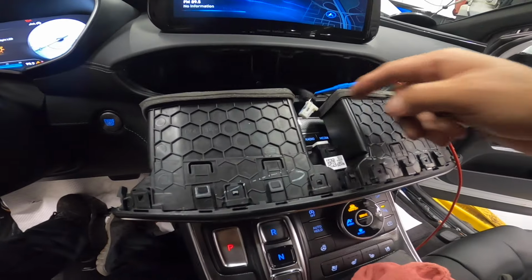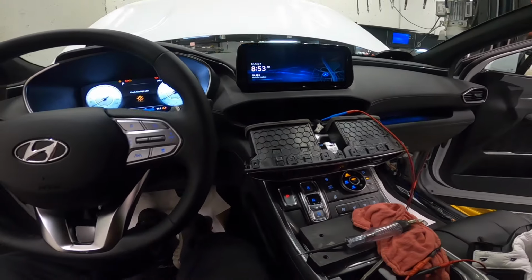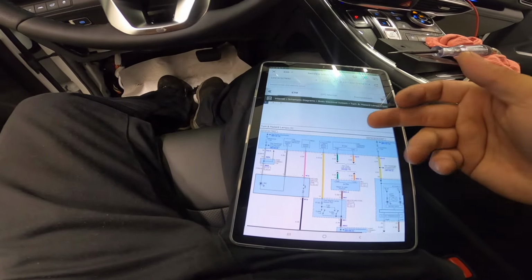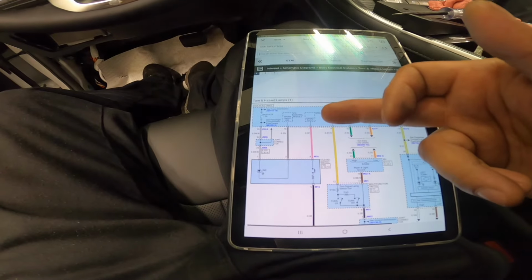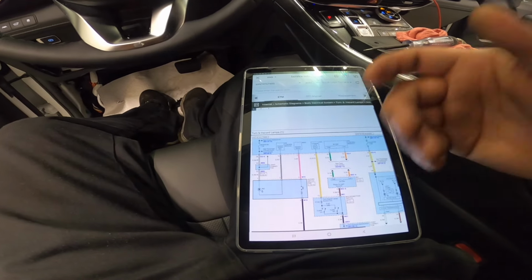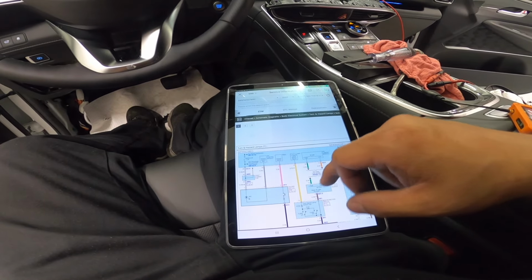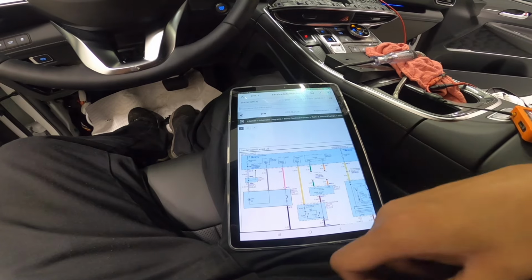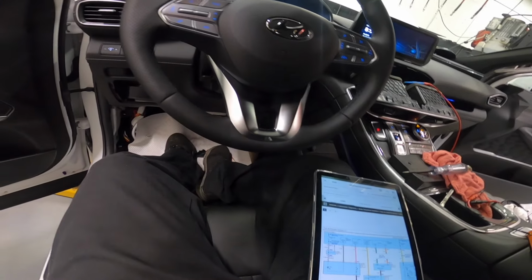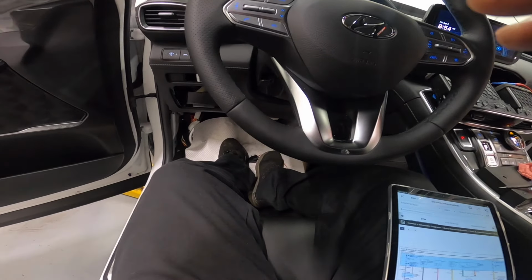Okay, so I connected our positive to this pink wire, which is that signal wire. It goes to the smart junction box, ICUF, this guy. But why is it still on? So I'm not getting ground there, which is good. But for some reason, it still wants to turn it on. I think everything points to the junction box though, you know? So let me remove this guy here and plug it and see inside there what's going on, and see from there.